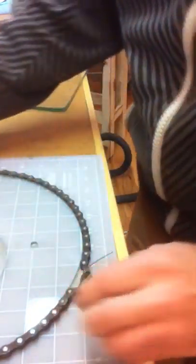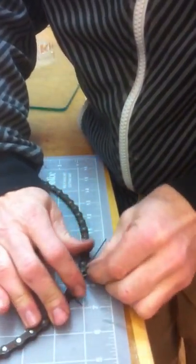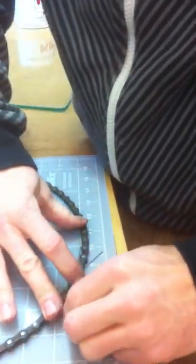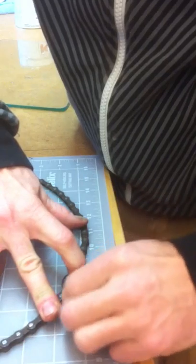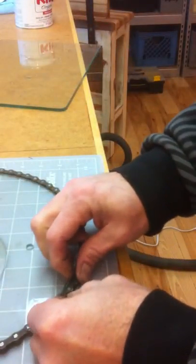You run your safety wire on the outside of the two roller pins, and put the chain together as if you were going to be connecting it with a pin. Then you run the safety wire through so it's about center, snug it just a little bit, make that center, and push these two together as close as you can get to the chain — that tends to work the best.